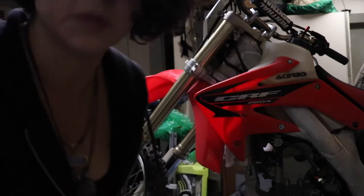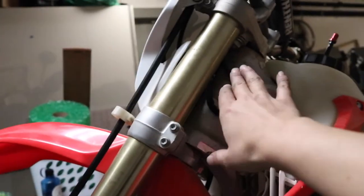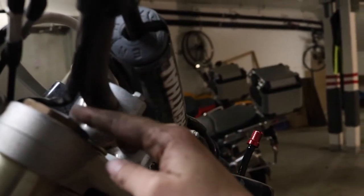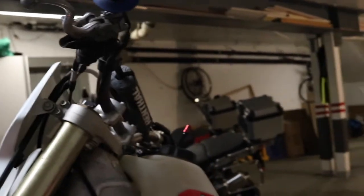Before I take the bike down, I'm going to lower the front suspension just a little bit. I don't have much room — let me show you what to do. I'm going to loosen up the bolts so that this whole bar here should be able to shift up. I'm not going to get that much space — you can see I only get maybe an inch there. I'm going to do it a little though, just because it's definitely going to be too high.